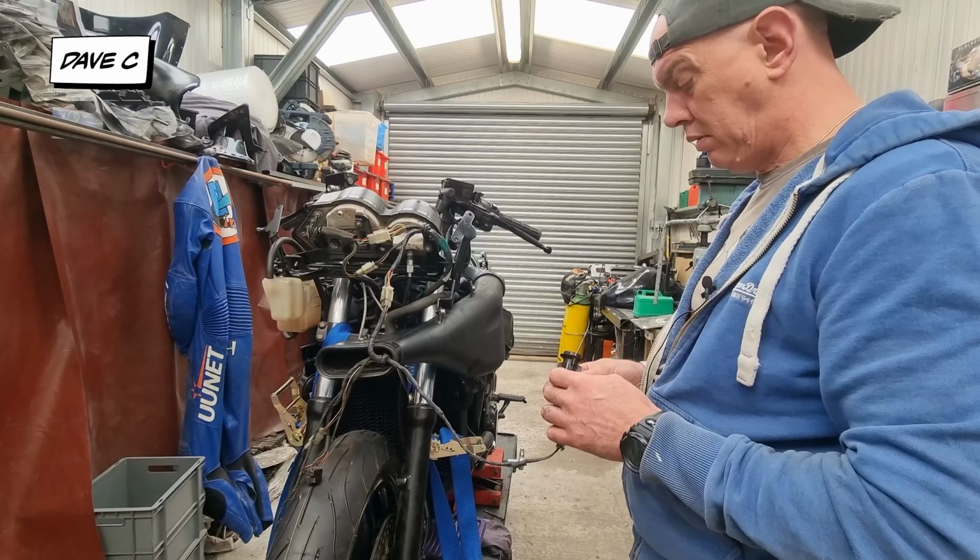Right, so that's the tank all scuffed up. Essentially, you're just looking for not having any shiny bits. Trouble is, I have got a couple. Like behind this little bracket thing, and right behind that one, I can't get in there and scrub it up. And also where the ring is, where you actually bolt the filler cap to, there's a ring that's set up from the tank, and you can't actually get right in there. So there are a couple of little bits. You know, this stuff I'm not too fussed about. You're not even going to see it, but the paint has got to stick to it.